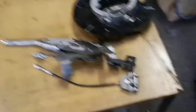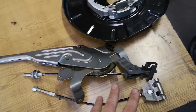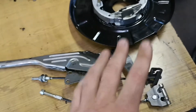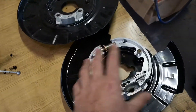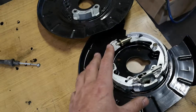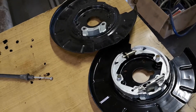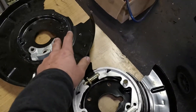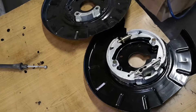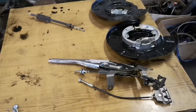Access to these bits in the car is a bit of a nightmare — you have to lift the rear section of the carpet to get at it, and there's a shield that covers this as well with three bolts to take out. These backing plates aren't too bad if you're not removing them fully, but if you are removing the plates, remember the wheel bearing has to come off, which usually means it gets destroyed during removal. So you're better off getting new wheel bearings, and be aware that the mounting bolts and the handbrake cables can be seized. Be very careful. Hopefully that helps you guys — hope everybody's keeping well and safe. That's it for today, thanks, bye.